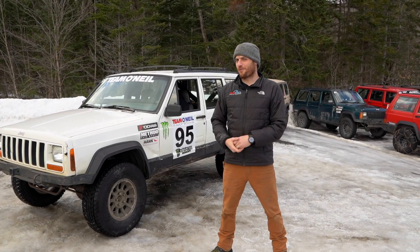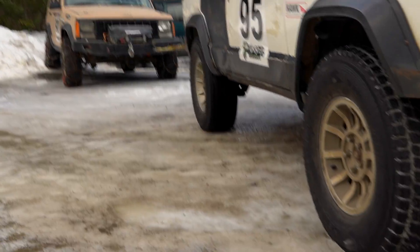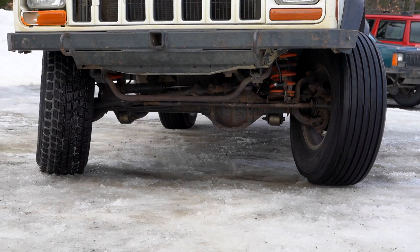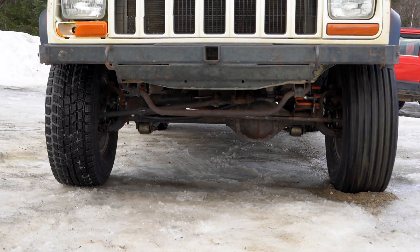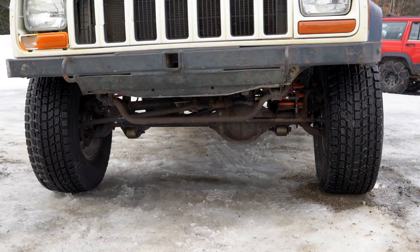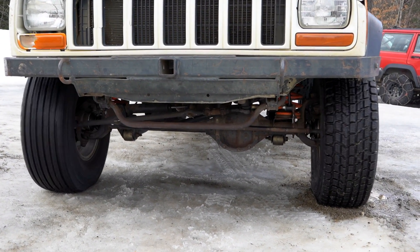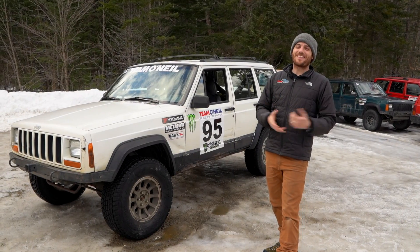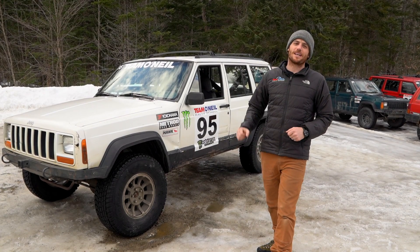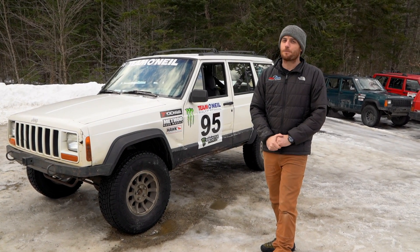So you've got a four-wheel drive vehicle - you should have four-wheel drive, right? That's the deal with a four-wheel drive vehicle like this. This is a normal true four-wheel drive vehicle with a normal mechanical transfer case locked into four low, transmission in first gear. He's just spinning the tires - the front and rear drive shafts are turning at exactly the same speed. This isn't an all-wheel drive - we'll do all-wheel drive next.